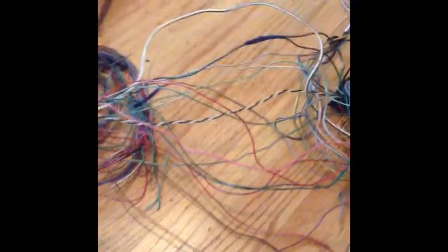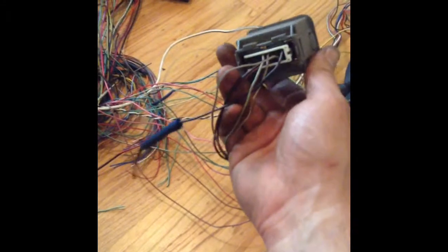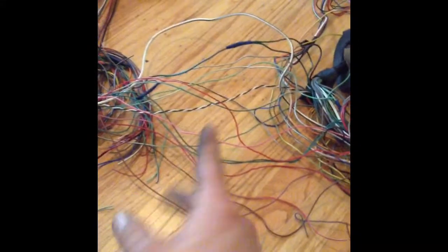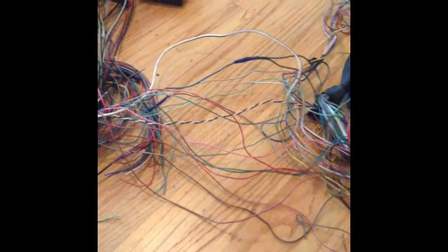And then there are various other ones. The only thing is, what I did earlier, I took the OBD2 port and found a brown wire that ran across here. Just cut a brown wire with a white, was it white? Yeah, brown with a white. There's actually two of them, so I'm just going to go to the ECU, see which one hooks up, or figure out where they both go.